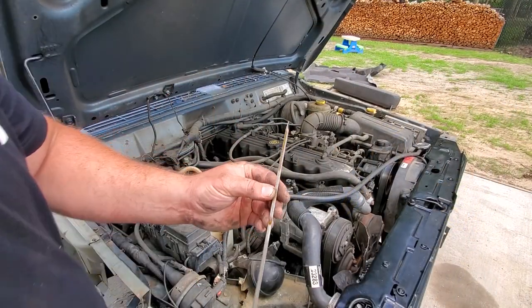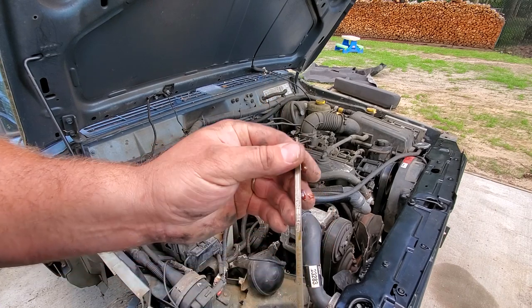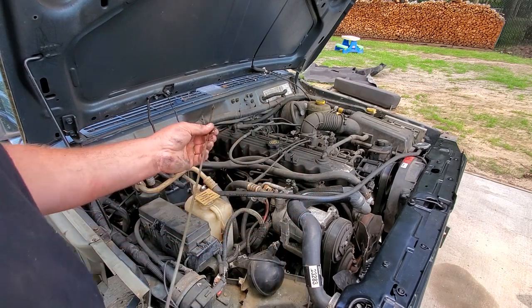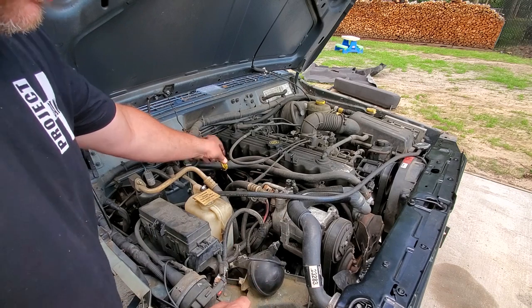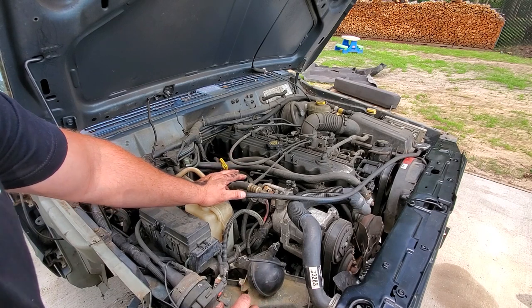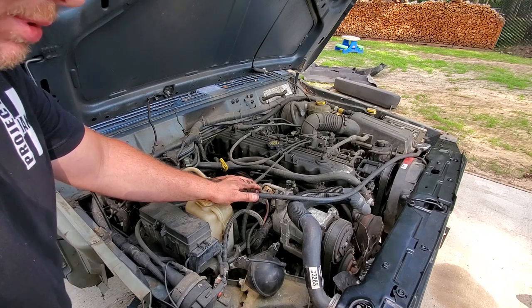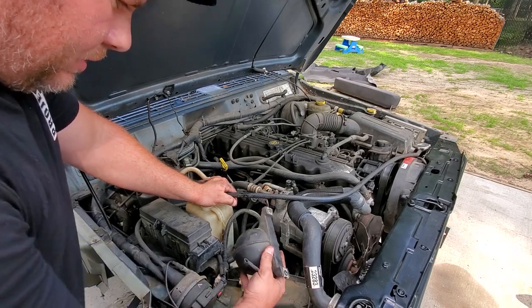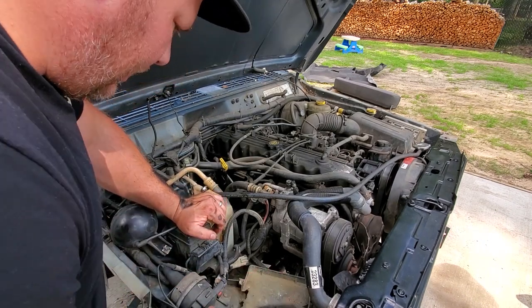All right, here we go. This baby's got a ton of oil, and this oil is brand new. This guy must have done maintenance on this thing literally right before he crashed it. So it's full of oil, it's new. I also was thinking about taking off these spark plugs and shooting a little bit of lubricant into the cylinders, but again, this thing has been sheltered. This whole thing is rust-free, so I don't think anything's seized in that. Maybe I'll put in some fresh gas, see if I could pump out the old, put in some new. Gas only lasts about 3 months, so I think I will go ahead and do the gas swap just a little bit. I don't want a full tank when I take this apart.